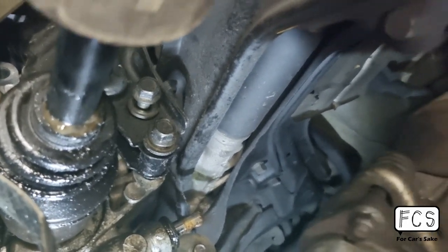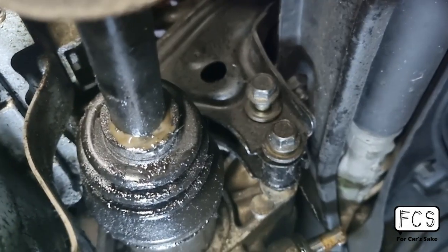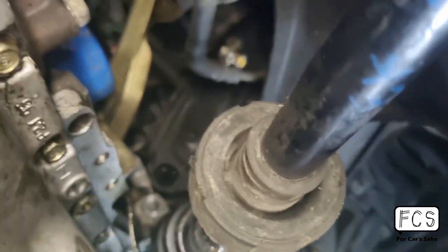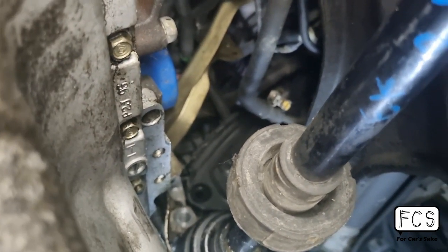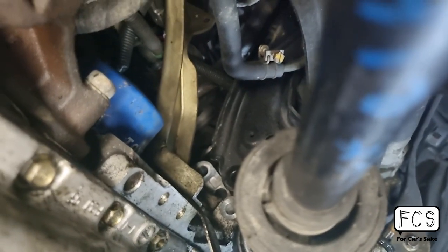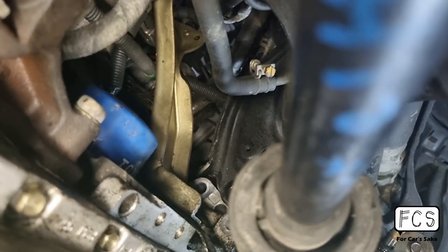Sometimes working on cars it really makes me depressed, but I've got no one else to blame but myself. So you see the T-bracket here. After refitting the drive shaft, I was looking at reinstalling the T-bracket, only to find that the top hole for the T-bracket — the shape of the T-bracket is different with the CVT gearbox, which means I actually need to replace that T-bracket as well. You can see the top there actually sort of droops down a bit, and just behind up there, that's where the T-bracket should go. So this is the wrong T-bracket.